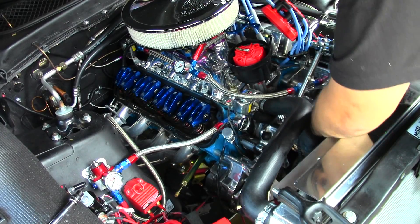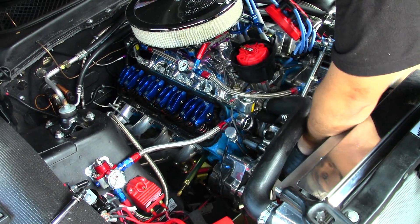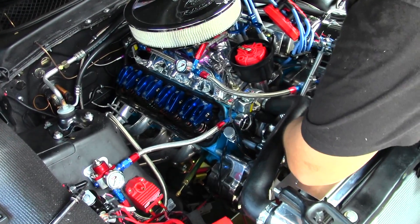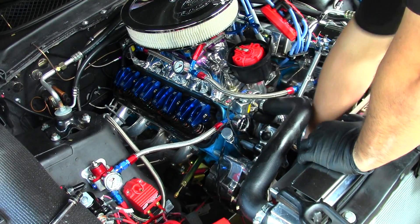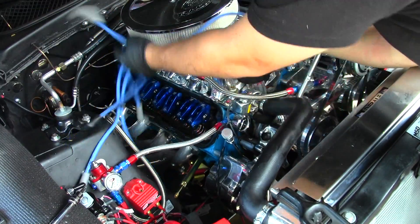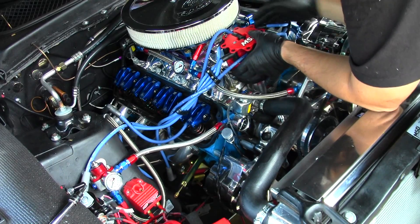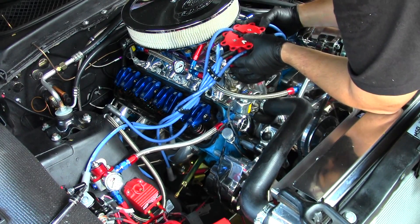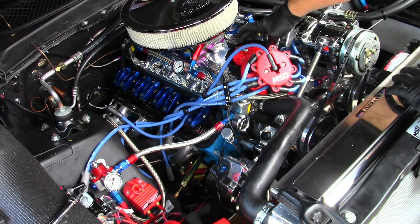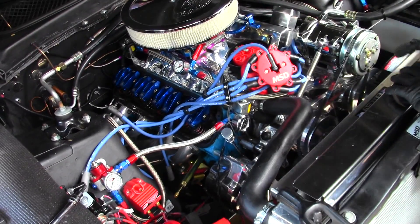So if we look at how I had initial timing set on this engine, just without using a timing light — let's back off the engine a little bit. That's where it starts to fall, and all I'm doing is basically looking at that brass tool. Right about there is going to be its highest point. When aligned properly, number one is here. And I'll make a mark on my actual distributor to show you, but I'm going to hold my finger here where it's supposed to be — and we're way off. So just that right there is really bad timing. That's what is causing the engine to run like absolute garbage.